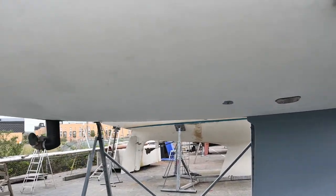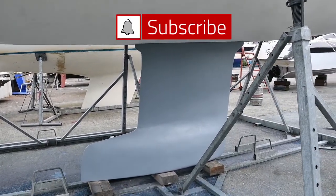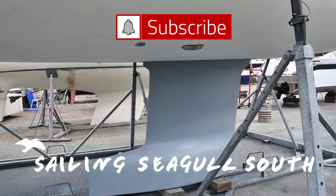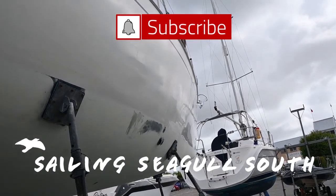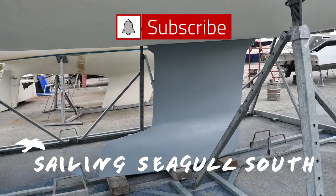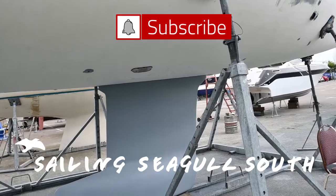So there's a little bit more Watertight to do, another coat on the keel of Interprotect, and then I think after a bit of sanding on where I've put all the Watertight on the hull, she's probably ready to go, but we have to leave it for 7 days for the volatiles to come out of Interprotect before we can put copper coat on. So making great progress, but still a little way to go.